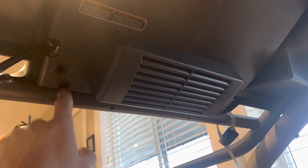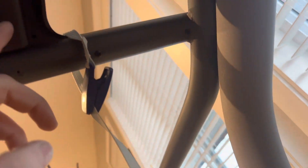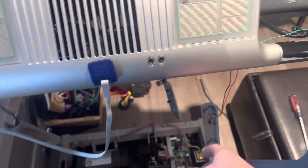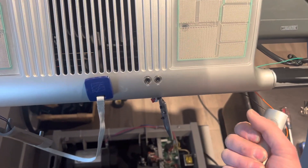To get in here you're going to have to disconnect — like I showed you — that red clip right here. There's a ground strap. Those two screws let this slide off, and you'll find the ground screw there. Then take out these screws, take this one out, take the screws up there, and take this out so you can pop that panel and move it out of the way. There are two screws right here and there may be some border screws, but those are your four major ones.